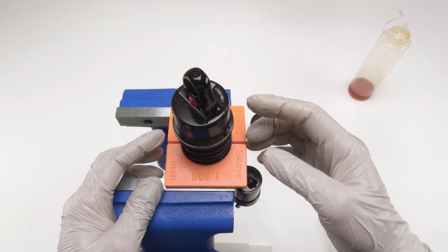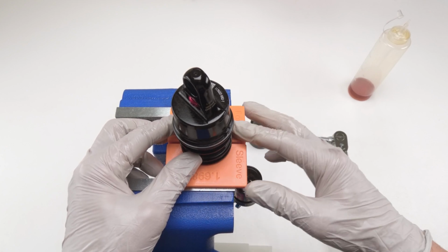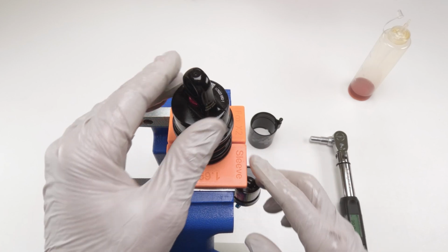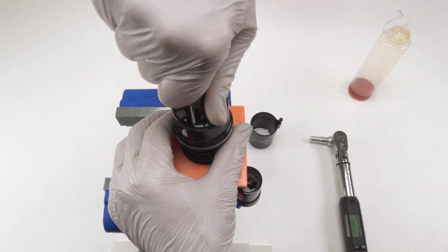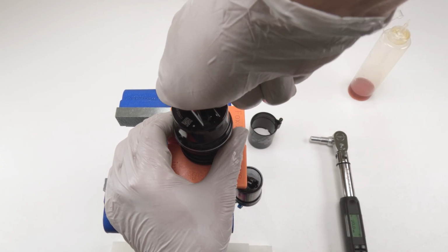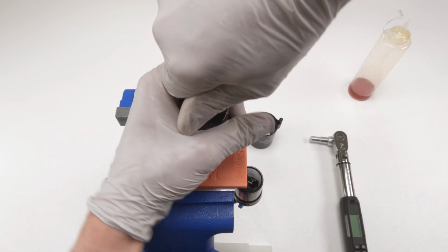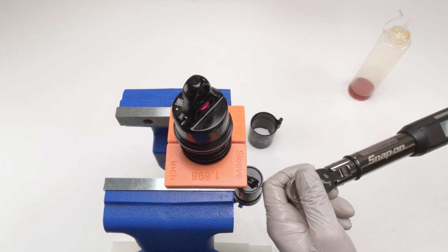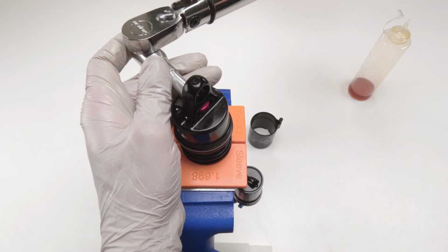And he is in. Next, we need to torque down the top cap to the inner sleeve or the inner air can. So we had to mount it back onto the vise with the X2 soft jaw. All right, so what we're going to do is screw it down by hand first as much as we can. There we go. So max I could do it by hand, 90-degree angle, 20 Newton meters just like before. 90-degree angle on this one.